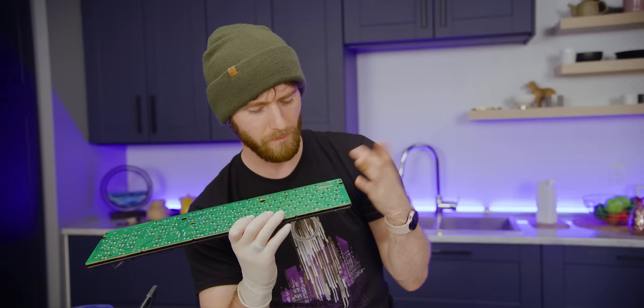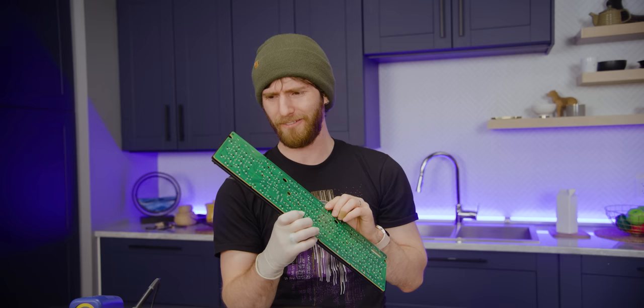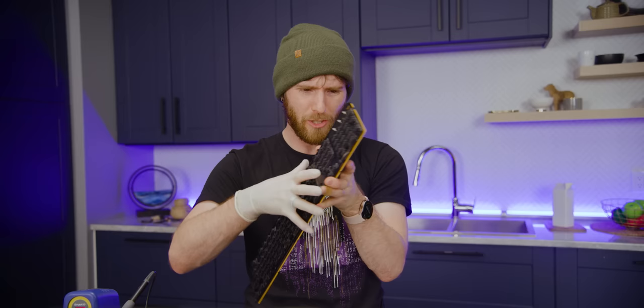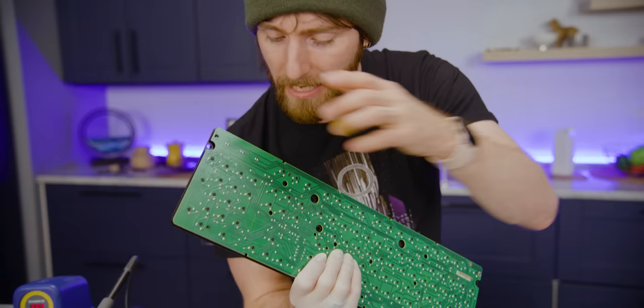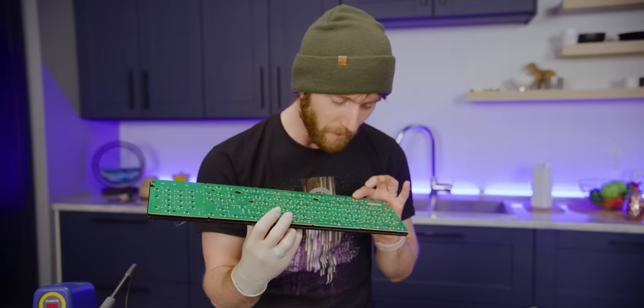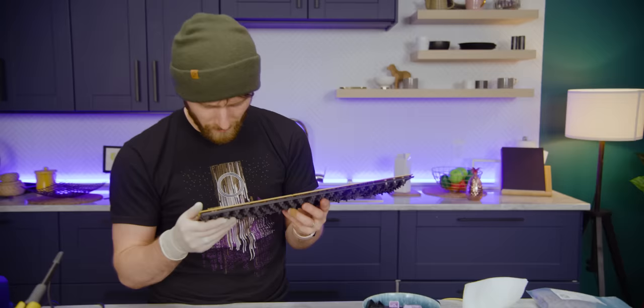And I think if we really wanted to, we could desolder every single key switch and then remove the steel plate, and separate these two layers. But they've been twisted into place with little steel tabs, probably for a reason, and it doesn't look like we have to pull them apart in order to replace just one key switch. So let's go ahead and have a look at which switch is coming out. It's gonna be this one, this guy right here.